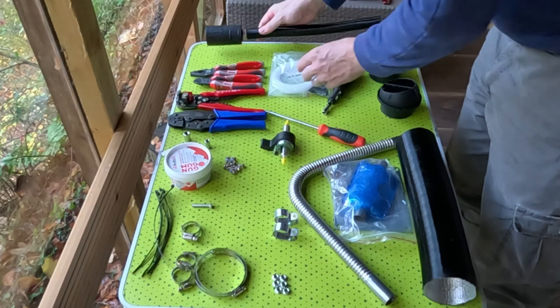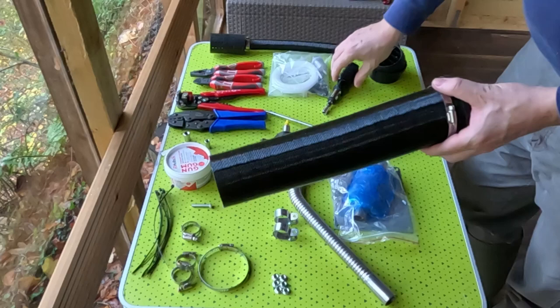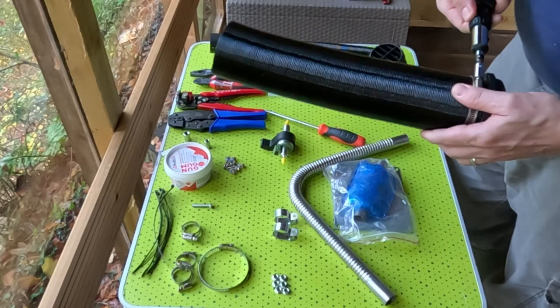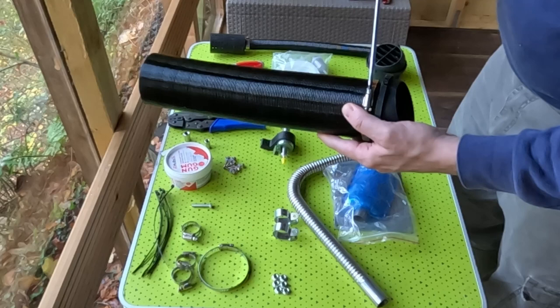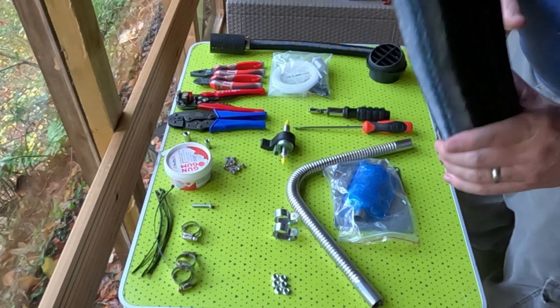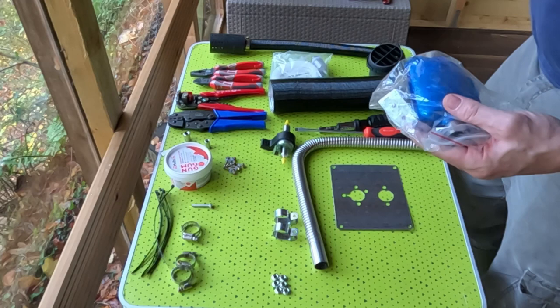And do the same thing with the exhaust for the hot air. Slide the Jubilee clip over. And again, just tighten that up. Doesn't need to be too tight. Getting over the head properly because of the metal coming through. Right. Put another Jubilee clip over there, ready to fix the heater. Okay. For the silencer, I'll fit that last because I need to put the exhaust through the shed wall, so I want to do that last.